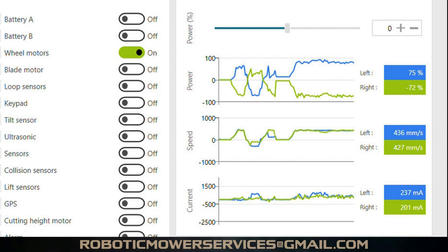That hill was steeper than what was recommended, but you also have to consider the tilt sensor — it was detecting a higher-than-expected front-to-rear inclination and trying to compensate with the wheel motors. So your wheel motors are what tells the mower it is in a collision with something, meaning you have all of that working against the mower as it's trying to go up a hill.